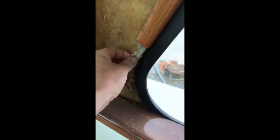Right, so we're going to pull out some more windows. So the third time I've done this because I keep losing the videos on my phone. These windows originally had this wooden trim, which hid all these screws, if you can see them down there, that are sticking out and holding the window in. So what we are hoping to do is get rid of these screws, tap into this fiberglass and put a metal thread in and have it finish flush.